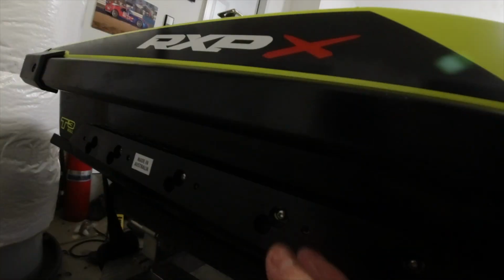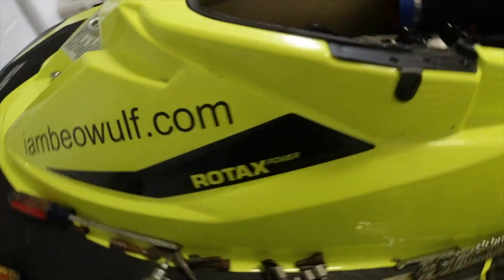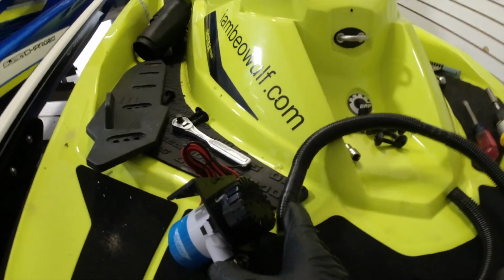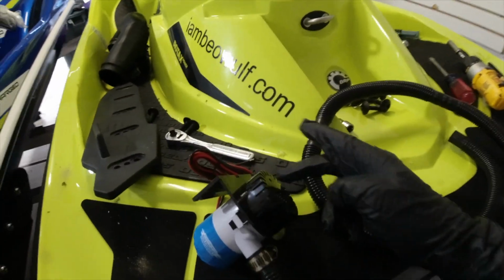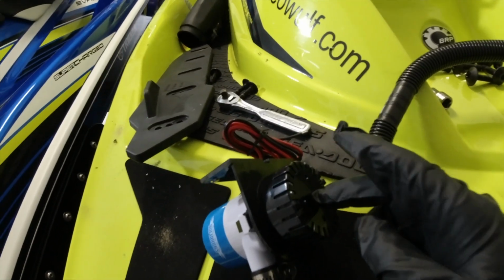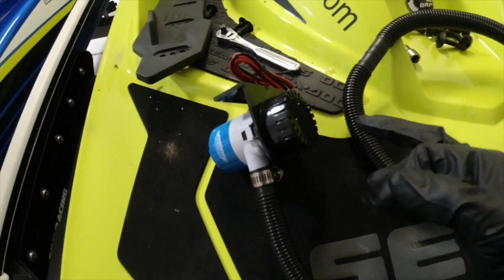Don't be cheap on it, because remember this is under the water line, and hopefully there's no leaks. So the next step is to install this. What you want to do is pop off, this is two separate pieces. I would silicone around the center, not here on these grooves, because that's obviously where the water pumps out. These are holes that would be for if you're using screws. We're obviously not screwing this in.